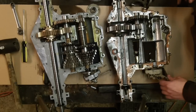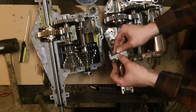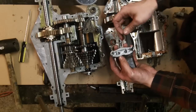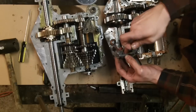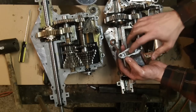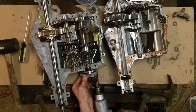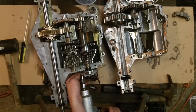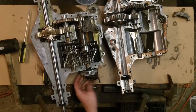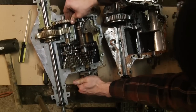We're going to swap on the caliper from the other machine — swapping this piece. We've got our rebuilt caliper with the particular push section that the Craftsman uses. Take the metal piece, make sure your push rods are nice and free and clear, all greased up. Set the metal piece on the inside, then set the brake pad on the inside, and then put it back on the side of the transmission. I know I'm about to get thoroughly yelled at for using an electric impact, but if you only go until the first click or two, it's really not that big of a deal. Brakes, no brakes, brakes, no brakes.